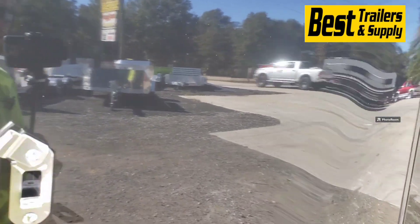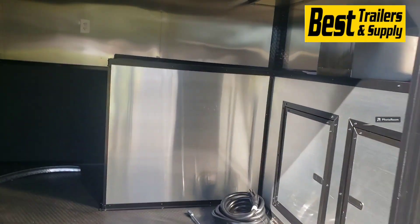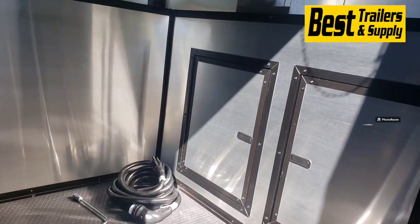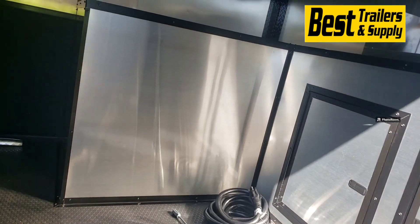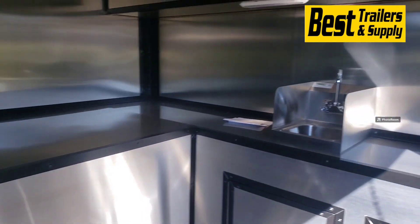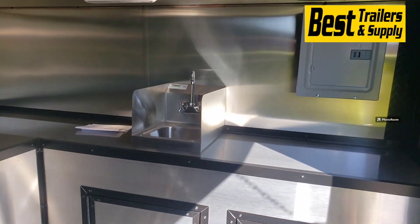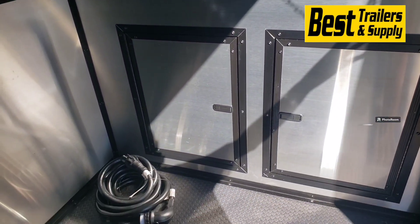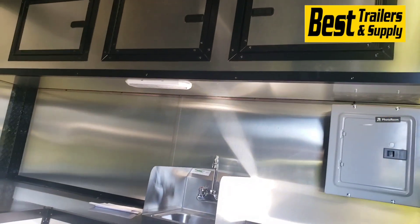You've got a 48 inch side door to get into the main part of the trailer. This will come with a 50 amp electrical package — that'll be your motor base plug there. The L-shaped base cabinets on the left side will be for your generator. The generator compartment will open from the outside on the other side. There's also a panel box and a quick hand wash sink on the inside, plus more base cabinets and overhead cabinets with an under cabinet light.